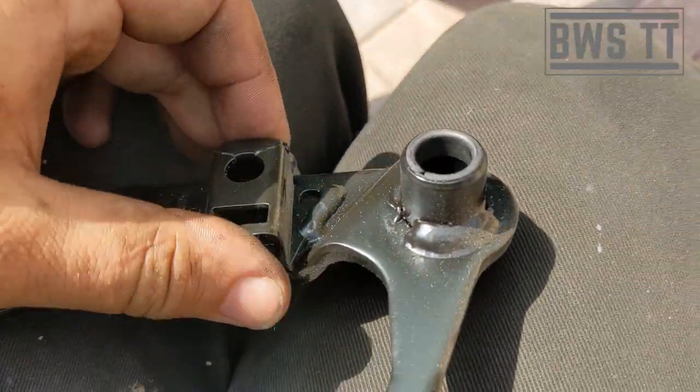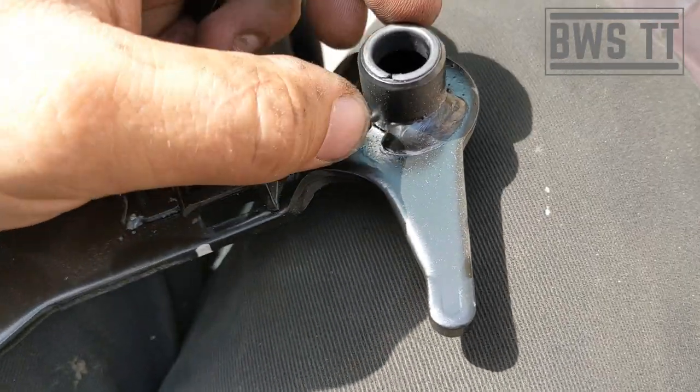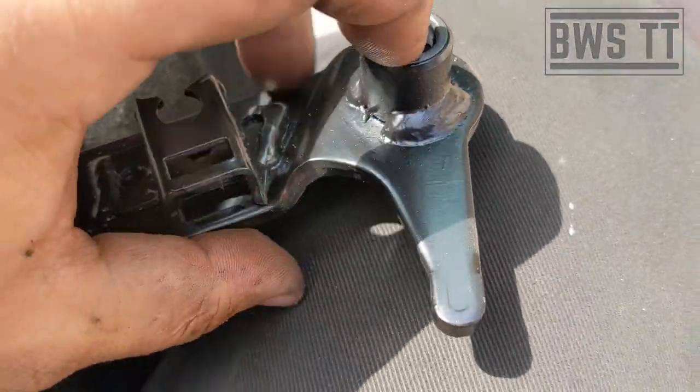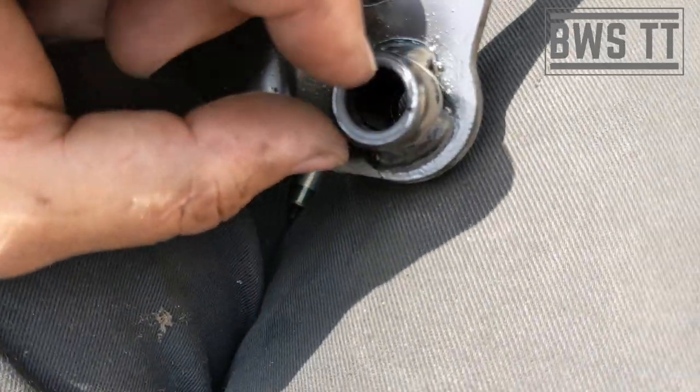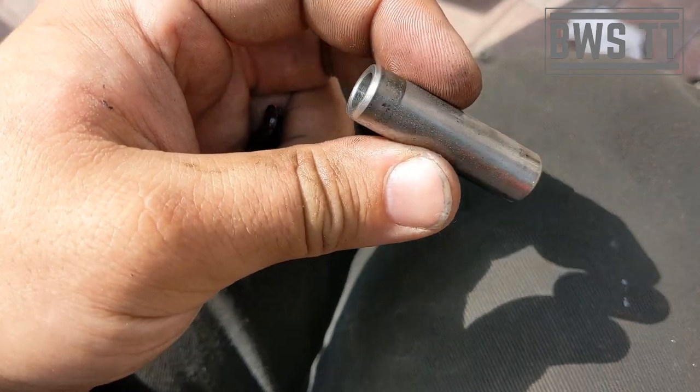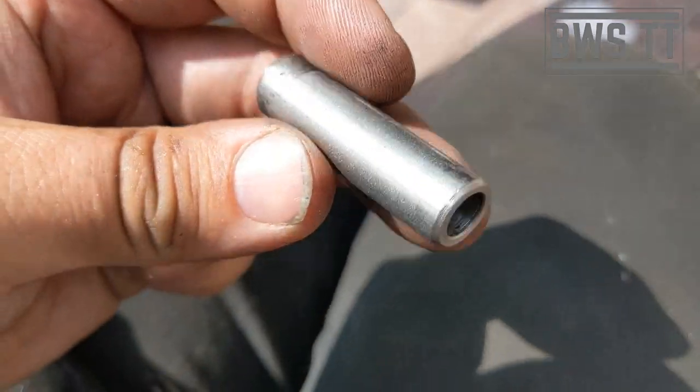This standard one we've got will work for now. When you receive the replacement pedal, check that it's got these collars in it. If it hasn't, move them over from your old pedal — and make sure you move this piece over as well, otherwise you'll be in trouble.